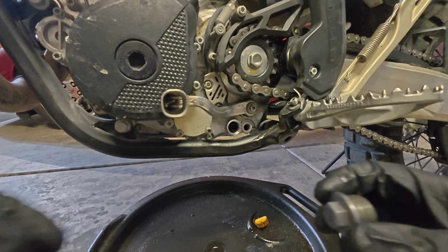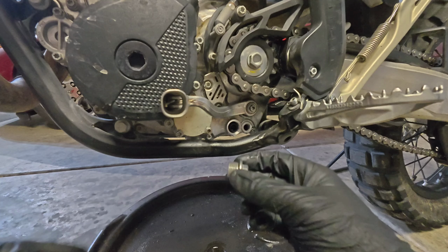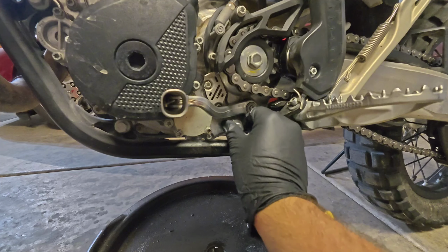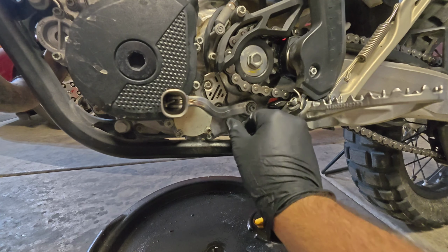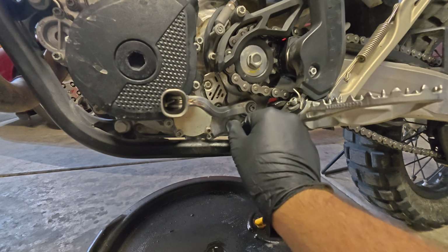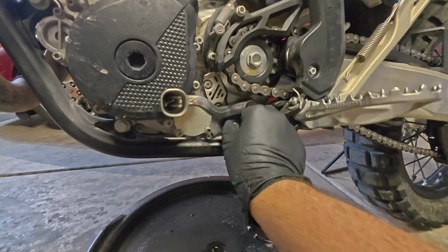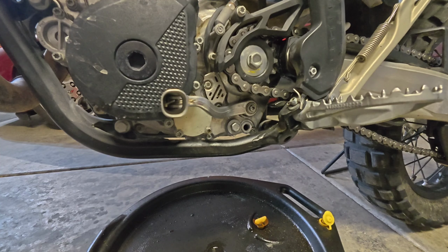Now it's time for the cap. See how it's hollowed out? That screen is gonna go into there. So make sure as you're screwing that in by hand, you want that screen to pop in there. If it's fighting you, something's wrong, since you should be able to basically bottom this out to the O-ring without any trouble. Mine's going right in there because I got everything all nice and square. Now I'm touching the O-ring for that last little bit. I basically bottom this out all the way before I put the torque wrench on there.